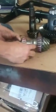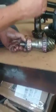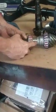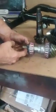This bearing can always move. It is on this thing, it's not supposed to move, but typically we're just gonna call it a movable bearing. It's resistant up against this, makes it stop. The resistance on this side is a nut, I don't have a nut, on the back side here that stops it here. So basically what you do is you create a situation where your bearing comes in and stops, and then it also stops from going outbound via the nut. That is what you call preloading.